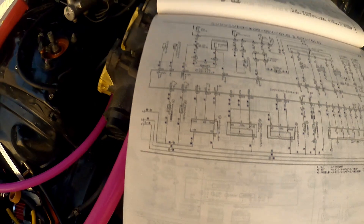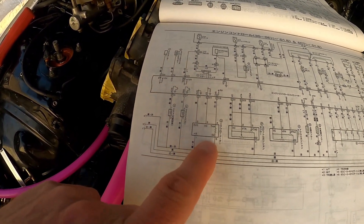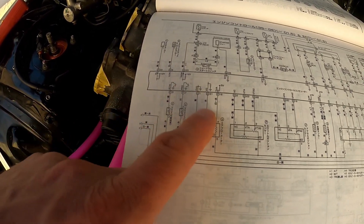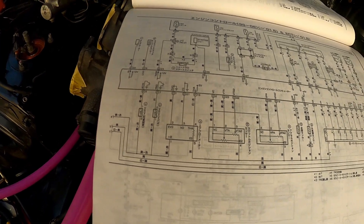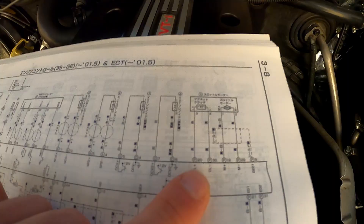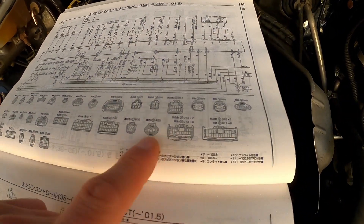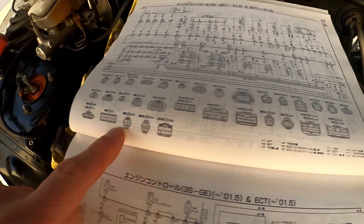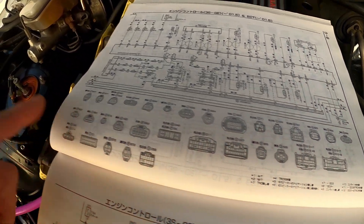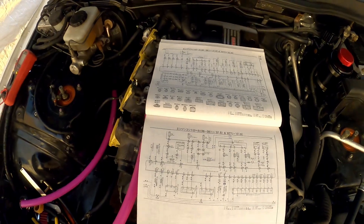There is also a red and a yellow wire for the airflow meter that isn't there anymore. So I'm actually going to have to go to the ECU, probe it, and do a continuity test to figure out which red and which yellow I want. I need P20 and P30. P is the plug, so we'll be able to find it here. It's on a different page it seems, but we'll figure it out and I'll show you how I do it.